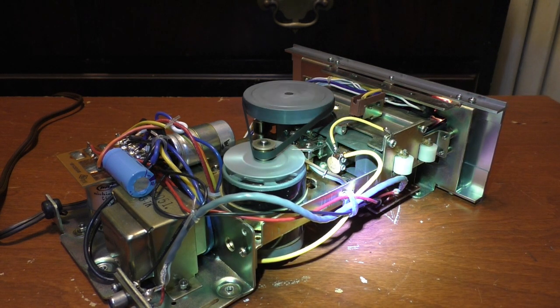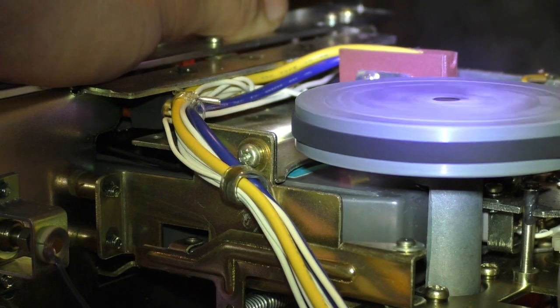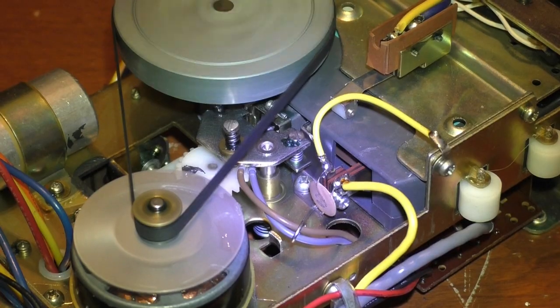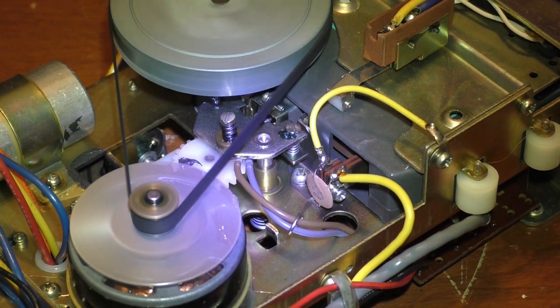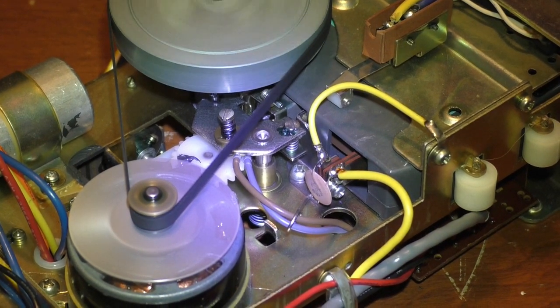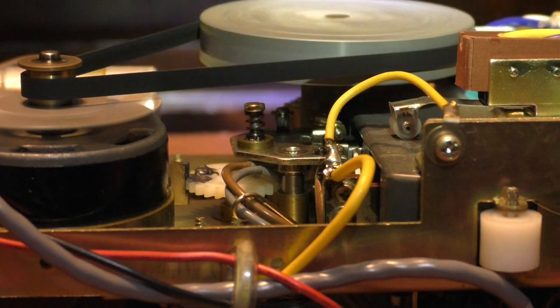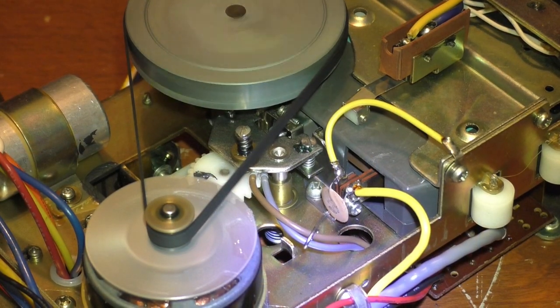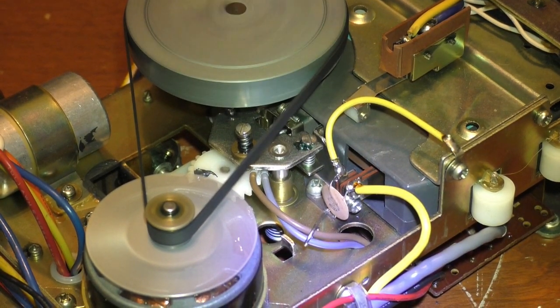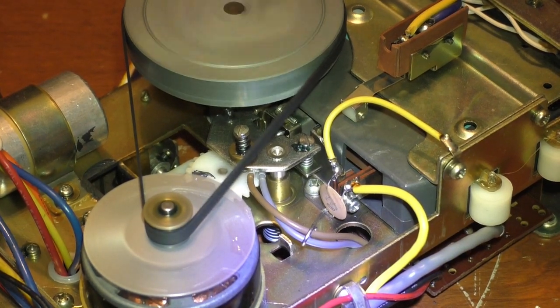So when we put the tape in, it's very user-friendly and starts running right away. You can see from the inside here, the capstan and pinch roller are pulling the tape across the head, which presses against the pad to help the tape play properly. It's reading from program 1 right now, and what's awesome about this is that if you want to jump to another program, just hit the button, and wham, program 2. This can also happen automatically with each rotation of the tape. The tape itself is held together by a foil splice, and when the foil passes by the connector point, it drops the head down and keeps playing.